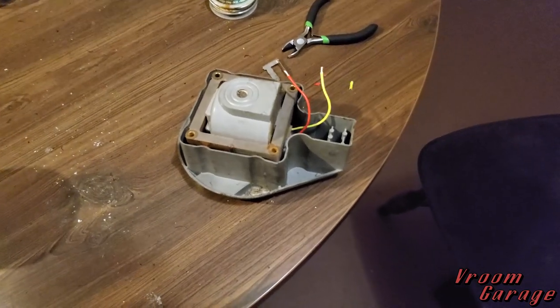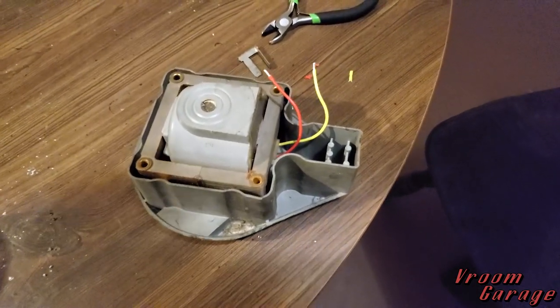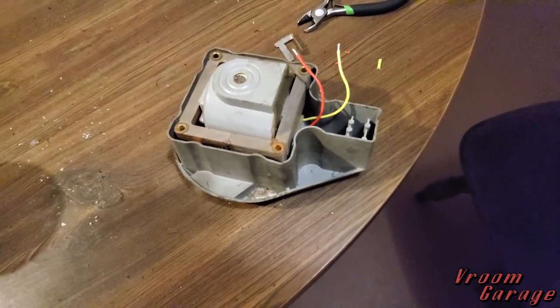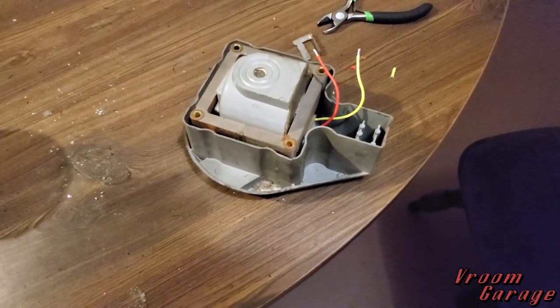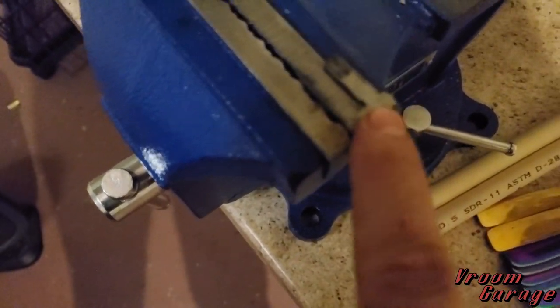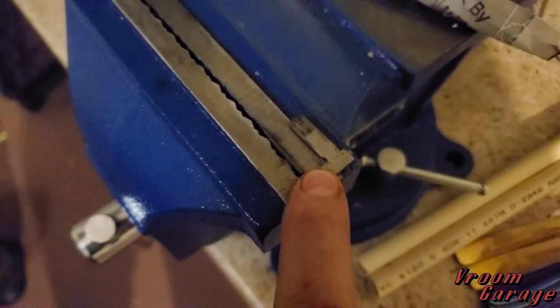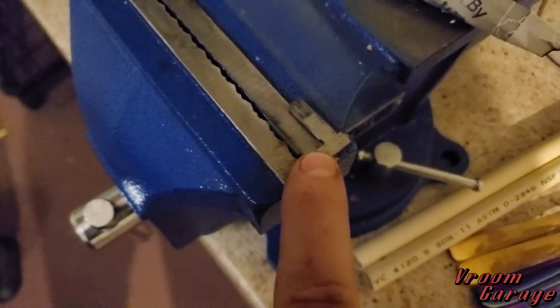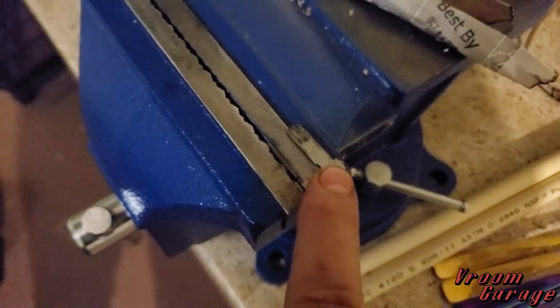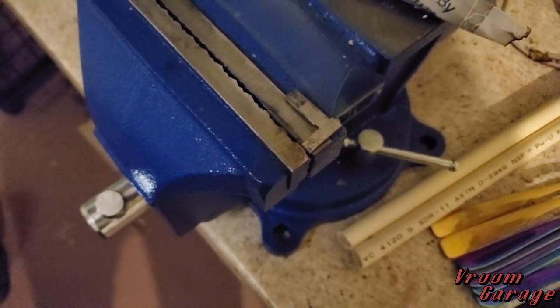We hit a small issue: the coil on the car — the blades are broken off. That's probably why I couldn't get the car to start. I'm going to take a small bit, put a hole through the blade. This is an Accel Super Coil 14003. I'll put a small hole in it, run a wire through it, solder it closed. Hopefully that fixes it and I can save myself 70 bucks.